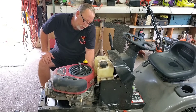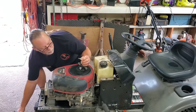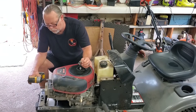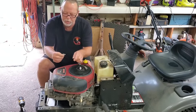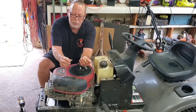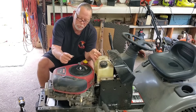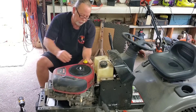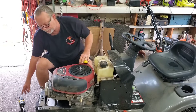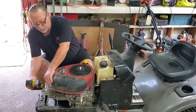It's taken me three weeks to get this doggone bolt. There we go. On these, when you're pulling this cover off, there's two different bolts — one has a short shoulder and one has a long shoulder. The long shoulder goes to the back, the short shoulder goes to the front. There are two bolts back here, two in the front — that's it. Let's get this off and I'll show you the rest.